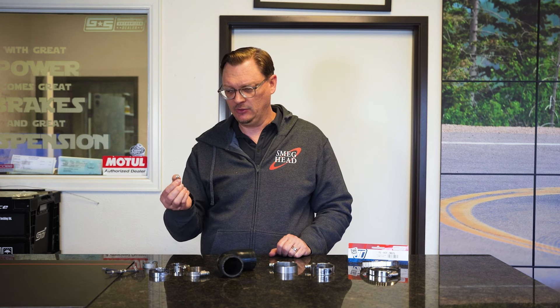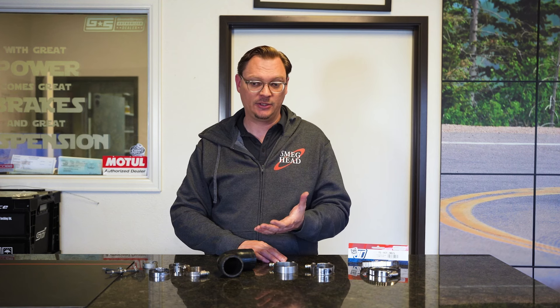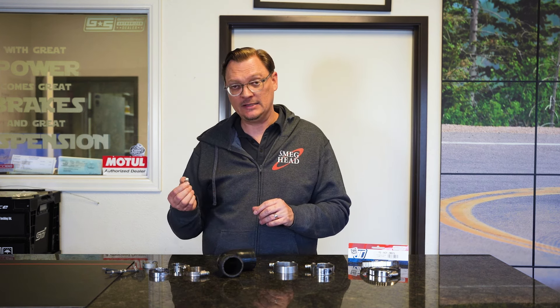When they're new, they're fresh metal rolled into a bend with a lot of tension. But potentially as they get old through many heat cycles — especially clamps close to something that gets really hot, like a turbocharger — they can soften up a little bit. So it's always good to check these things. If your car is old, with a hundred thousand miles or more, it's often good to replace these spring clamps, and new OEM spring clamps are typically the way to go unless you're able to get in there with worm clamps.